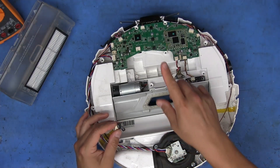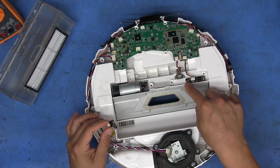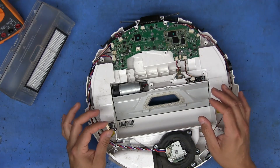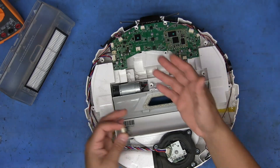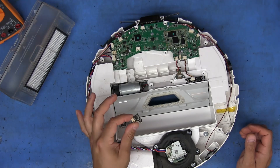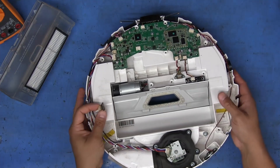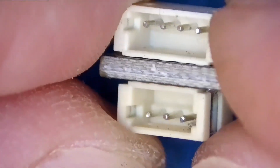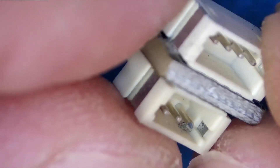I just had something interesting happen. None of the LEDs around the buttons or on the small board where the reset button and Wi-Fi indicator LEDs are had lit up. But as soon as I disconnected this board, everything lit up. I turned off the unit and turned it back on, but they didn't come up again. So I don't know if those LEDs not coming on has something to do with this little board as well. I guess once I fix it, we'll see what happens. That was completely unexpected and unfortunately I was not recording when it happened. Interestingly, this board has two connectors on it, so I'm guessing it must have been used on two different model vacuums.